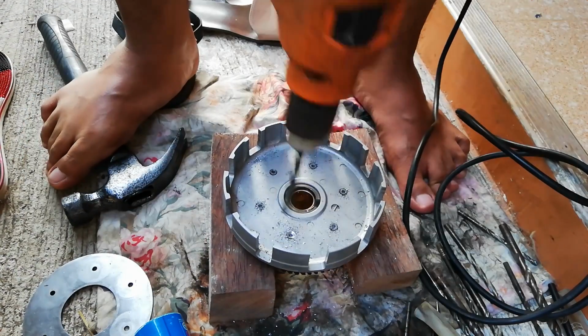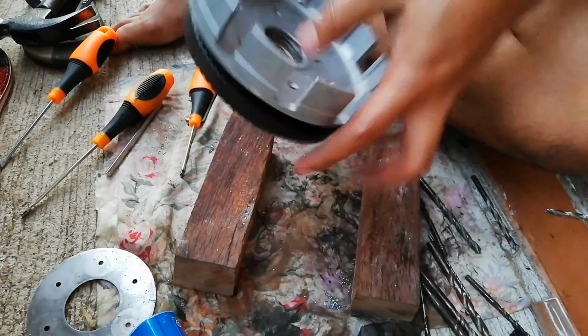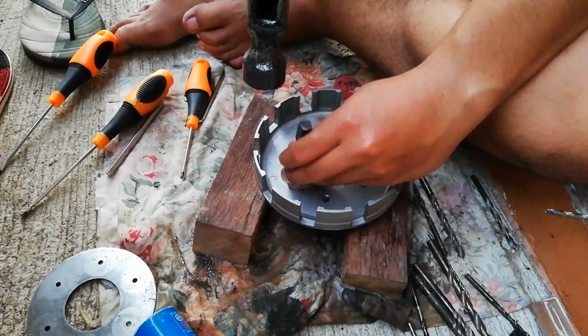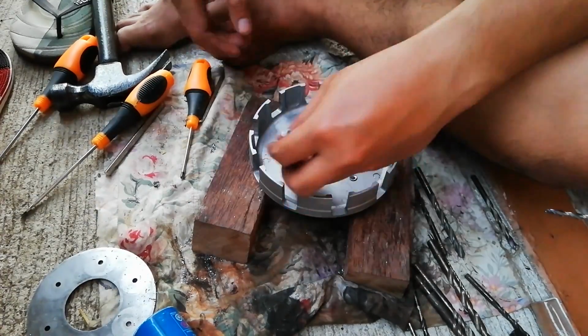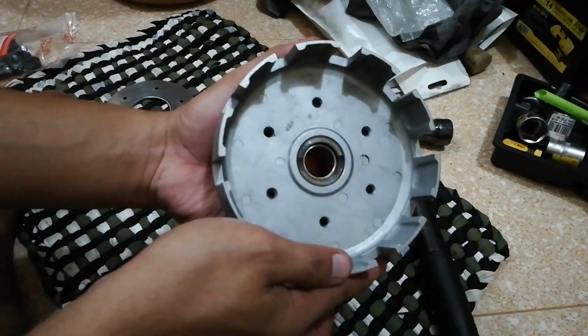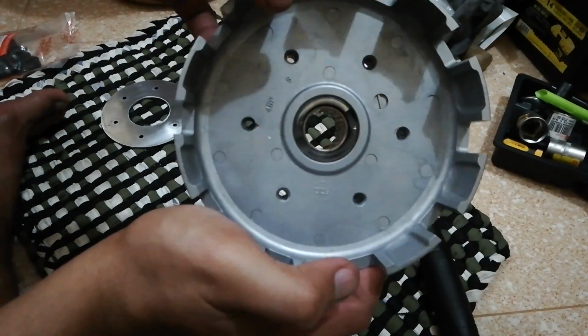After doing the same pattern of drilling where we use a bigger bit on this side, we go ahead and use the center punch or any improvised metal that you have, as long as it is narrower and it fits through the holes that you made. You just need to gently punch it down to push these annoying rivets out, and bingo. I did this to all rivets and it worked. I was able to remove all the rivets out.